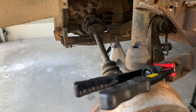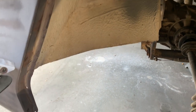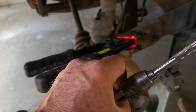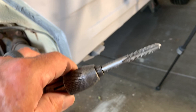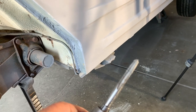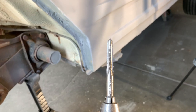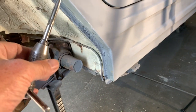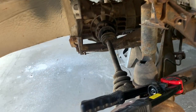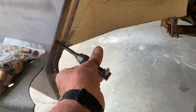So what I'm going to do is, holes that are good, and the bolts actually came out, is I have an 8mm tap. You can see it right there. Got it on Amazon along with, I think it's a 6.75mm drill bit. It comes with it in the kit, and I'll put the link in the description from Amazon where I got it from. But 8mm is what all the fender bolts are. So I'm going to take and clean out the holes with a little bit of oil on this tap, or run them in and get the holes nice and clean.